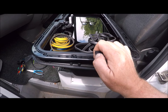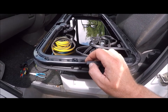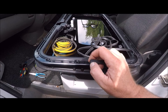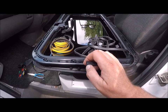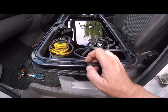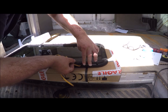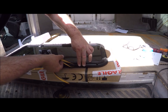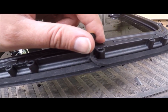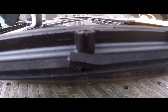When you're applying the tape all the way around there'll be extra — you overlap it, don't cut it off level. I've seen someone cut it flush and try to superglue it, but the instructions say overlap it by at least 5mm. The reason is that once it's bolted down it stretches, and if you've cut it exactly flush it'll come apart — and that's when you'll get water ingress. So overlap it by at least 5mm. Trim the overlap to 5mm — there we are.